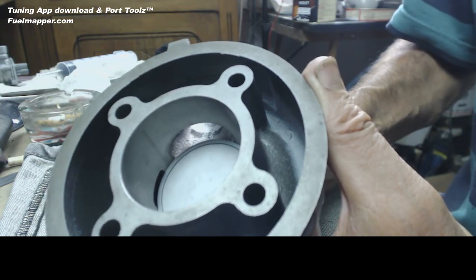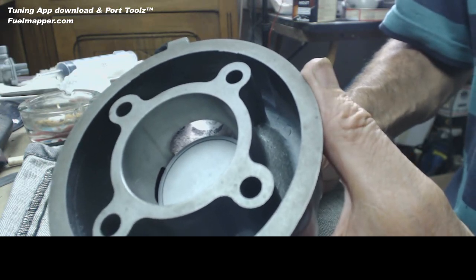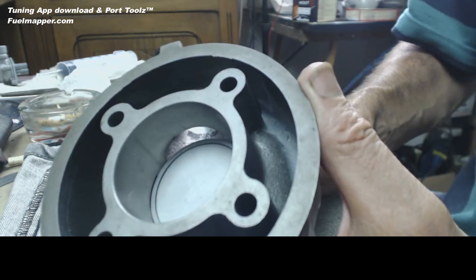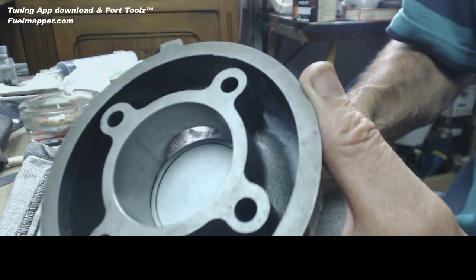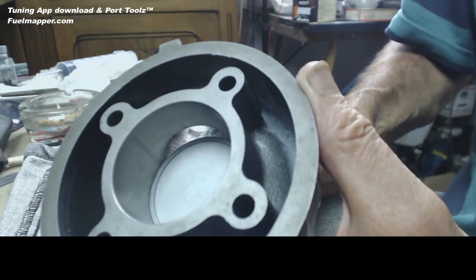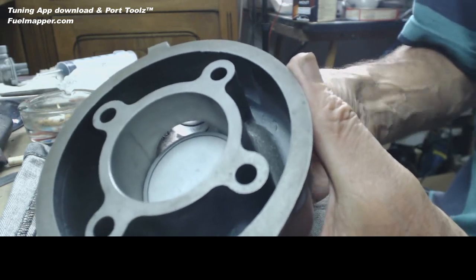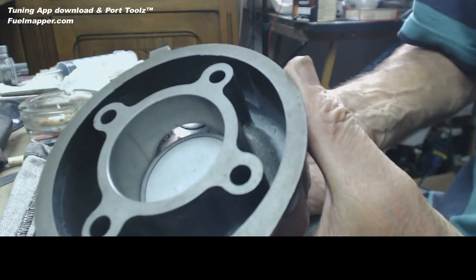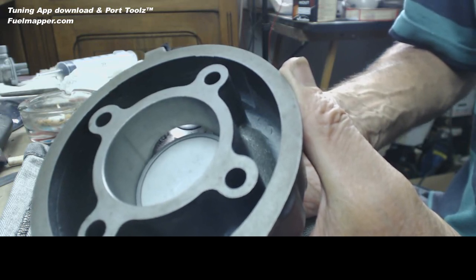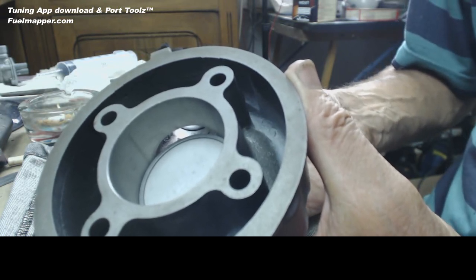This is why often at the edges there will be scratch marks, because it's already damaging the piston ring. As it rises it reaches the top of the main inlet port, and this is where it will meet the sharp edge and scratch. For the exhaust port it's now at the widest point and it needs to be reshaped back to the side, so it's now being squeezed against the exhaust port bearing surface if it has one.